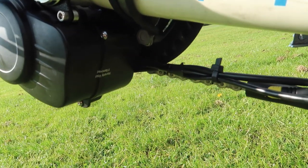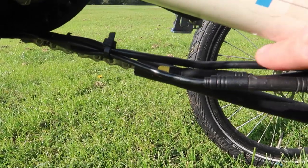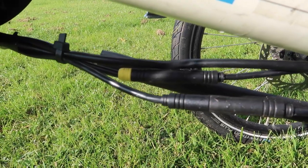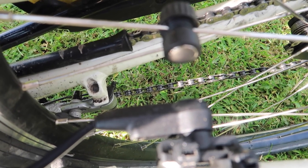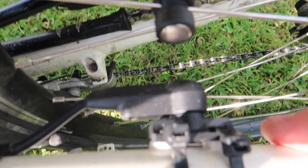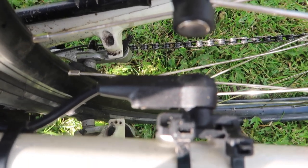Whilst we're under here — there are three cables that are already pre-attached to the motor. They come out of the rear and are colour-coded. Those three cables attach to the battery, the speed sensor, and the controller. There's nothing complicated with the speed sensor at all — it's your usual magnet-type sensor. The magnet attaches to one of the spokes, and as it passes the speed sensor attached to the frame, held on with a couple of cable ties, it registers the number of rotations and tells the controller exactly how fast you're going. That cable runs down to the motor and plugs in at one of those three cable connectors.